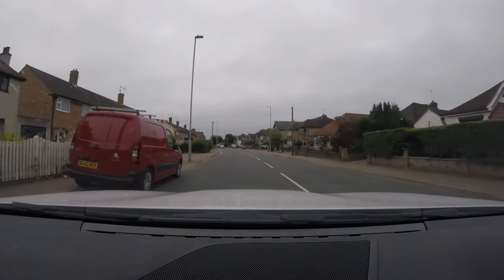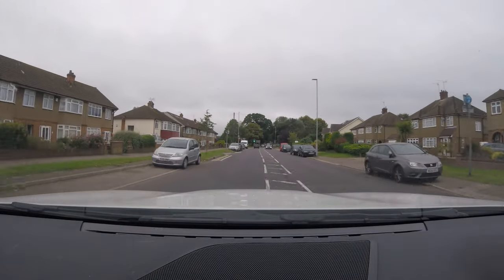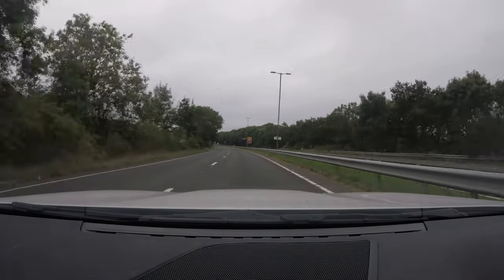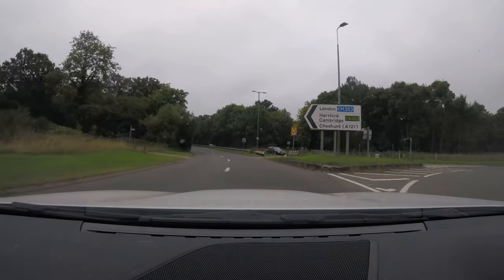A few days later we're on our way to the gym and then to get the car aligned. Currently we've got it set at six square and it feels great — anything will feel great over stock. One thing I can say for sure is the body roll has disappeared and the car settles a lot quicker. Some roads around here — go over one bump and you'd be bouncing for two to three seconds — now it's close to immediate, which is great.